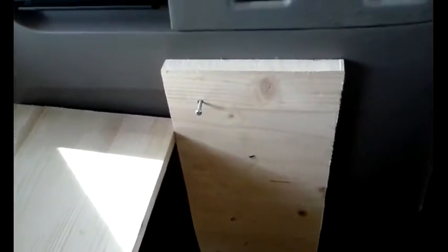We're nearly finished with assembly of the van. This is the bottom brace for the right side of the bench — or the left side if you're sitting back there facing the front. You can see that's the rear bench area. I basically just line up this piece to the edge of the bench to hold it in place, but it can still allow it to come out. It's just to keep the bench seat from sliding forward while you're driving. I used three screws to hold it in place. The measurements on this unit: going across is 7 inches and going vertical is 14 and 1/2 inches.